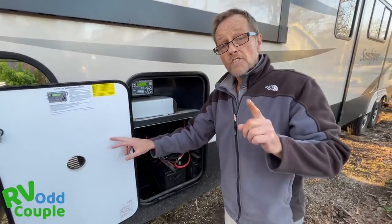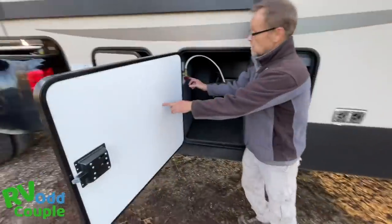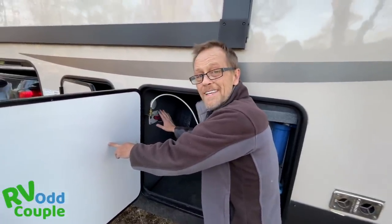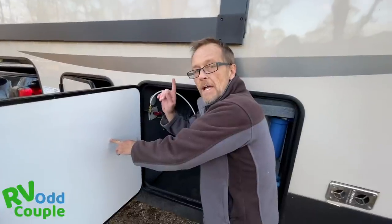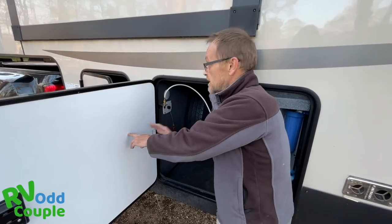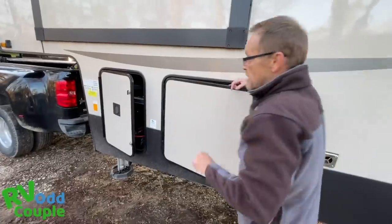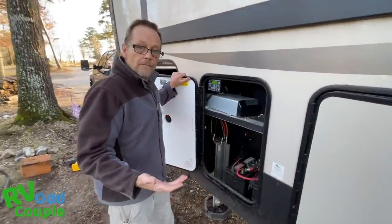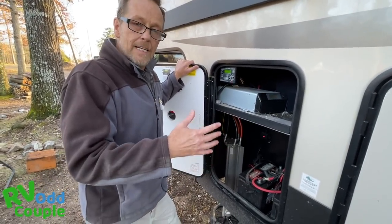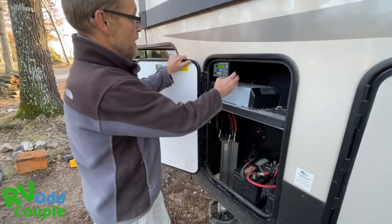If your battery isn't working, double check your battery shut-off. Our battery disconnect is back here. I checked this — it was off. Our landing gear works when this is off, and that was one of the things that popped into my head that nobody from the thousand comments caught. The battery disconnect keeps my battery from drawing power when not in use. Battery disconnects are wired in all different ways, so check to make sure you know what yours does and whether your landing gear will still work if you shut it off. Every RV is different.